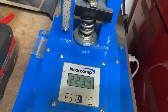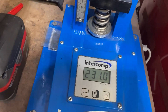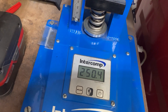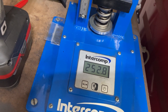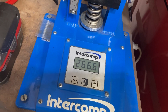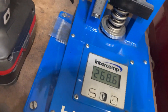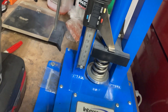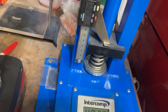At 1.860 inches, we are at 220 pounds — and that's not going to cut it. I'd like to see something probably up above 250 to give me some warm and fuzzy feelings. Let's see what 1.770 does — 270-pound seat pressure. If we subtract our 700-lift cam from there, that would put us at a 1.070-inch open height.